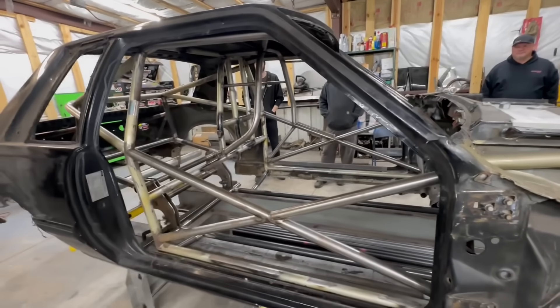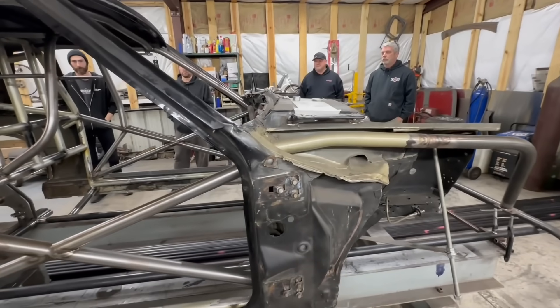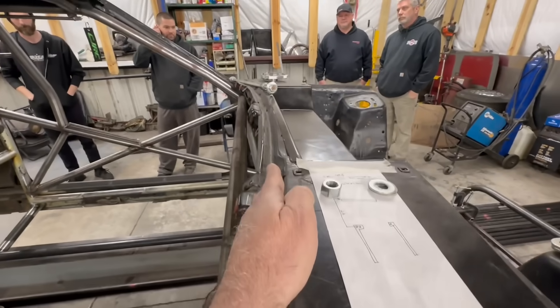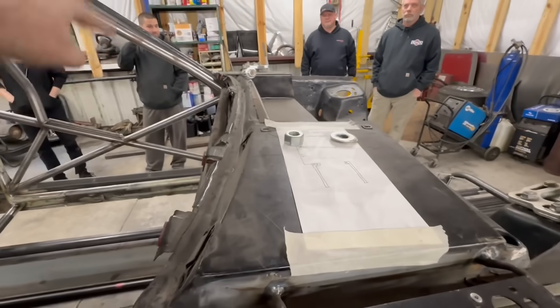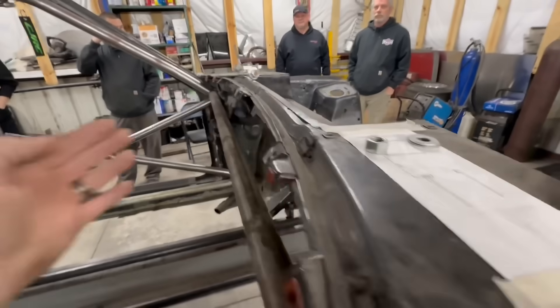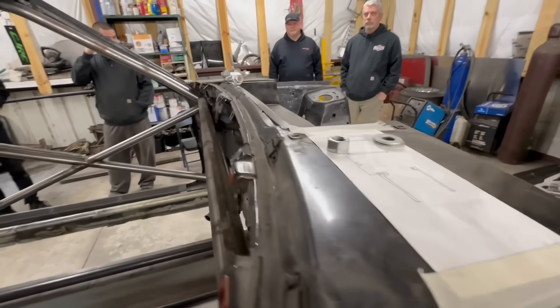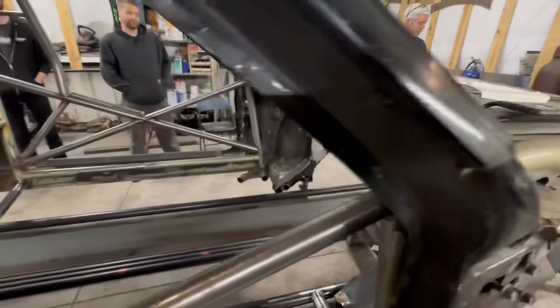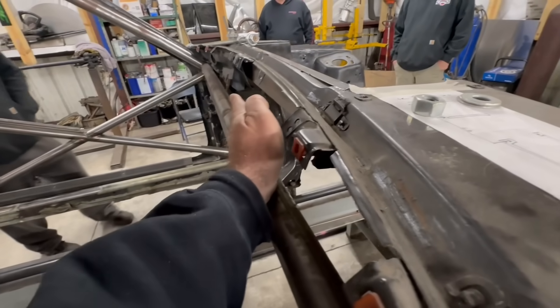That's why I cut all the jailhouse bars out of it. This ain't going to be a ride-along car. The windshield of course is going to be here. Pro mods cut big X windows, boxes out of the windshield since it's set back so far. It would make it easy to set the motor right here - this is the 75 inch point right here. Five inches forward from here.